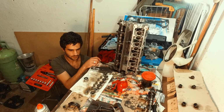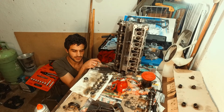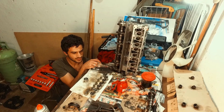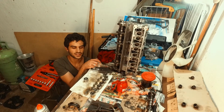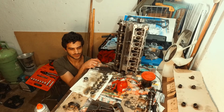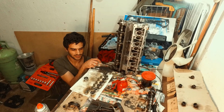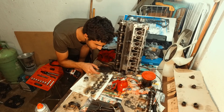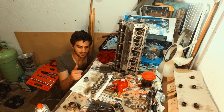The lifter reinstallation didn't go as smoothly as it did taking it apart. Turns out lifters are pretty difficult to put back together. It says that I need to ensure that the body of the lifter is aligned with the housing, otherwise the retaining clips aren't going to clip in. I don't see anything that needs to be aligned, unless it's these lines, but that's just the cap, not the body. I don't know, so I'm going to leave them as they are now.